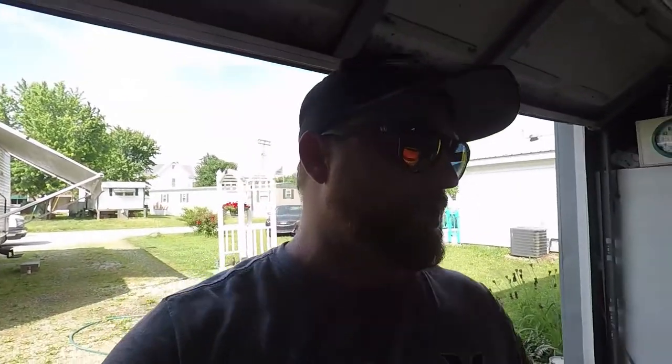All right, so let me know what you think. I mean, it's not the loudest thing in the world. Obviously, being in the garage makes it a little bit more loud, but it has a nice tone to it. Pretty happy with the way the tone is. I do wish there was a little more of the noticeable cam lope that you would normally get. But it's a little easier to do it this way than have to mess with the valve springs and all that good stuff. With that being said, it would have been a perfect time to do that kind of thing when the engine was out of the car. Neither here nor there. It is what it is.